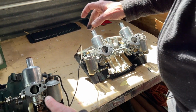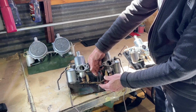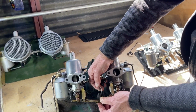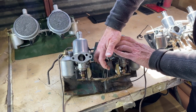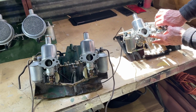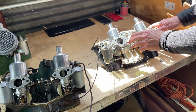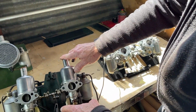I hope that helps you a great deal. That's a critical area. This is the other thing about the H1s that's kind of cute and annoying at the same time, is that this is where the choke pulls from this little stirrup. The cable actually goes through here with a stop, and that's how they designed it. It does work, but it's much more efficient here to actuate that with this linkage. It's much cleaner, it's much more trouble-free, it's much more consistent, and when you need it, it generally works on these, and on these they're usually, as I said, all worn out.